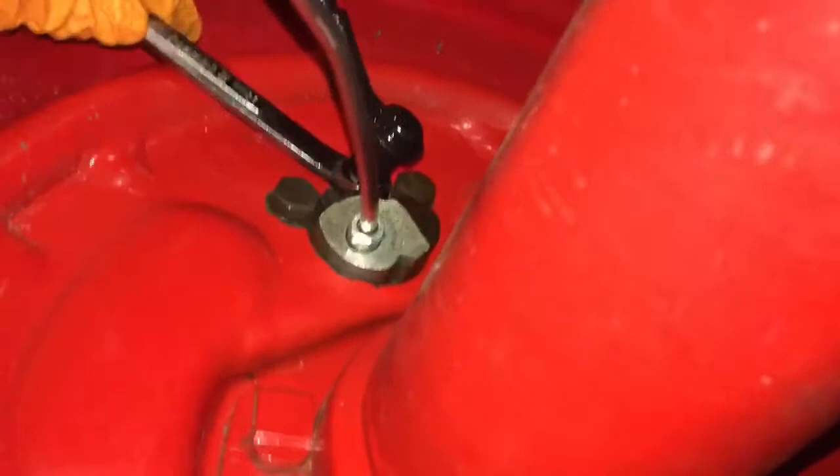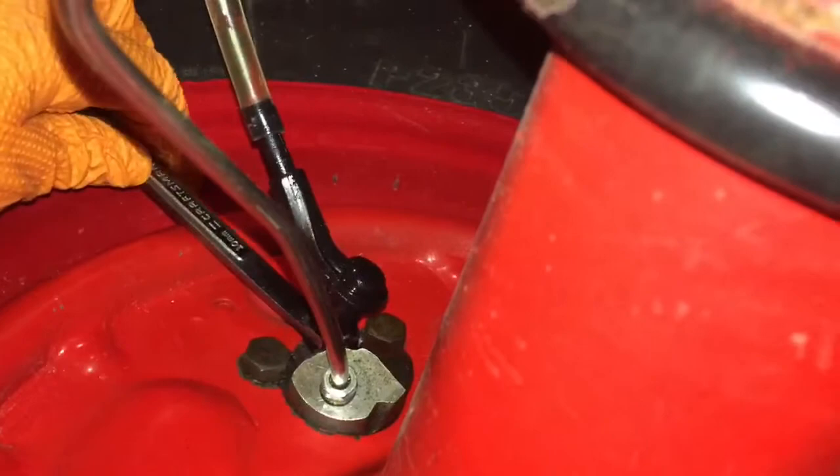Right now I'm bleeding the rear brakes — I just got the front ones all done. I'm using a MightyVac system so I do have some bubbles because I did have some leaks right here with this fitting, and then again over on that fitting. It wasn't that bad, it was just enough to leave a little bit of a dribble on the tire. They're all tightened up now and I'm doing the best I can bleeding these using the MightyVac, then I'm going to use the one-man bleeder once this is done back here just to be sure everything is good.